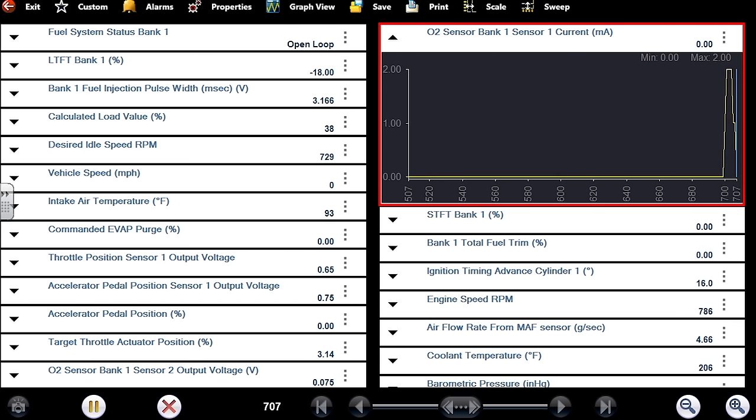After seeing 40% engine load and then disconnecting it going to 26-28% engine load — to me that says that thing is overestimating airflow. For ten dollars it was worth going this route rather than checking everything else out and coming back to the mass airflow, which is really what you end up doing anyway. Sometimes calling a module is the hardest thing. A mass airflow sensor is a little module and when you see hash running through it, that's a clue.